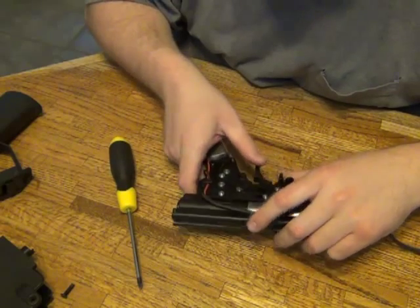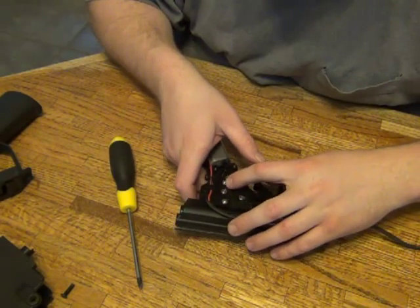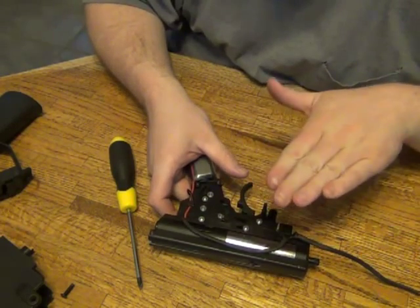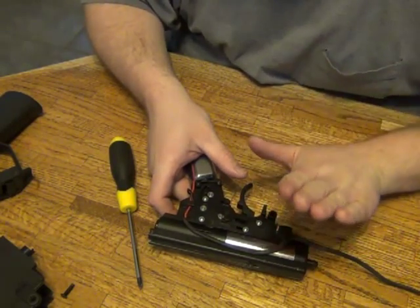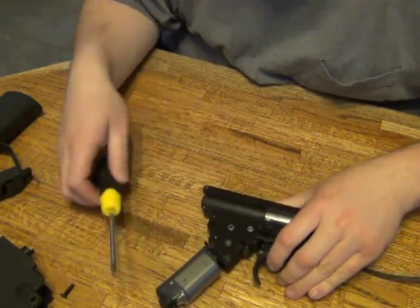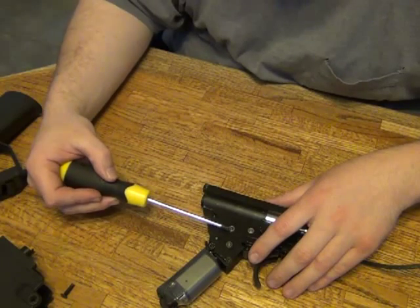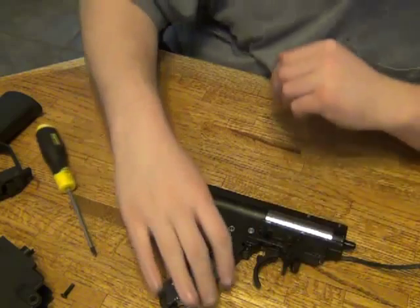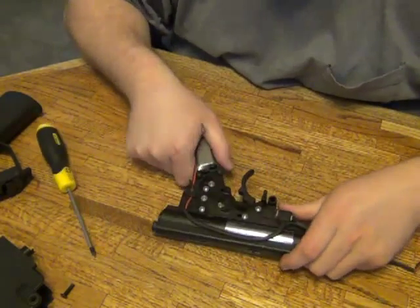So the sector gear right here doesn't have anything wrong. It looks like on this side it doesn't have anything wrong, but if it was shimmed improperly, it should have done it to either side the way it's propped. But it only did to this side, so from right now what I conclude is probably dirt. Some of that grease falling down in there, but we'll go ahead and open it up and check and see.